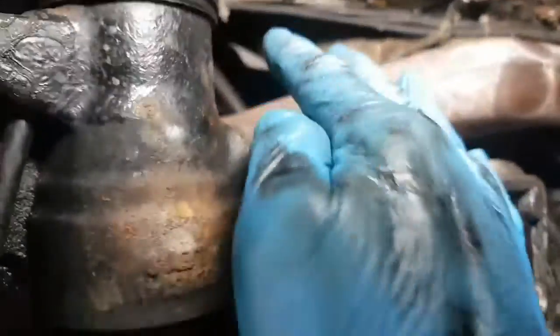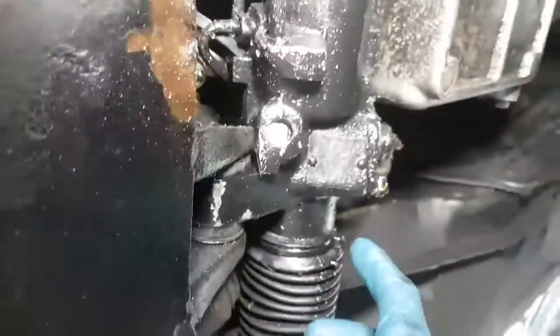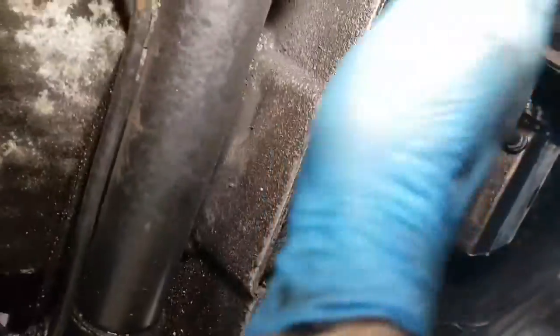But it was dribbling. It wasn't spraying out before, but it was clearly dribbling for months, if not years. There was oil everywhere, and there still is oil everywhere. This is a real mess under here. There is a hose under here somewhere, which I managed to change last night, that goes round the bell housing, and that had been leaking quite badly. And see, there's oil everywhere, it's all dribbling off the gaiters. I don't think it's steering oil, I think it's transmission oil.